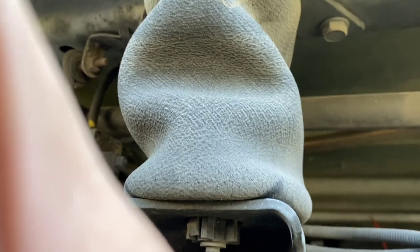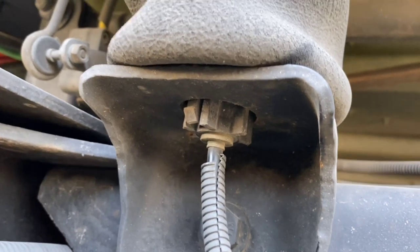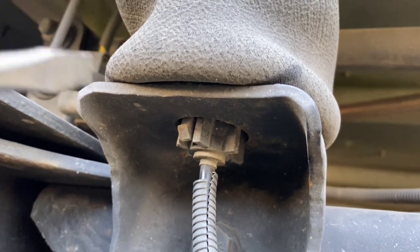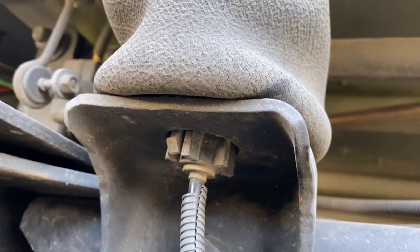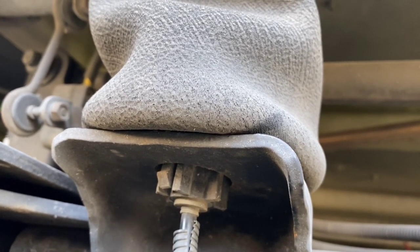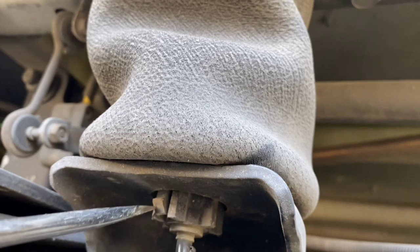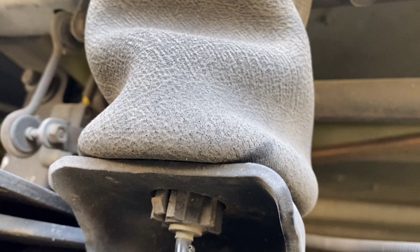I want to show you the bottom here. You see some clips — this is what we're going to use the screwdriver for. Right there is a clip, and what we do is we push that in, which releases the airbag. That clip is actually keeping the airbag from jumping out of that hole. This is the end of the airbag right here, and this clip just needs to be pushed in and then the airbag can be brought up.